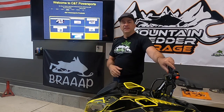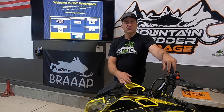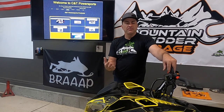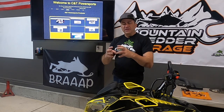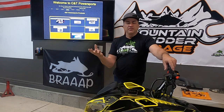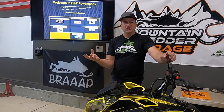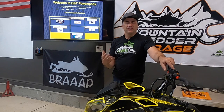I hope this video is helpful for getting your Ski-Doo maintenance done and keeping it running good throughout the winter. I'll keep checking these SPI rollers after every ride to see if they hold up as good or better than the Ski-Doo ones they replaced — the Ski-Doo roller cages were all broken up in there. As that plastic cage gets chewed up and the pieces break down smaller and smaller, eventually there's no cage left, all the bearings can move around freely, and then you've got metal on metal and some real problems. So keep an eye on your rollers — if you've got a thousand miles on your machine, I'd definitely take one out and see what they look like.